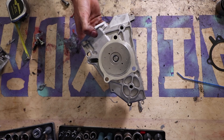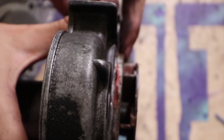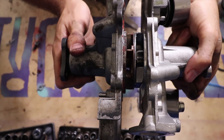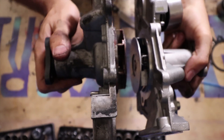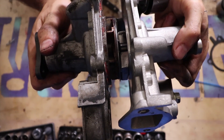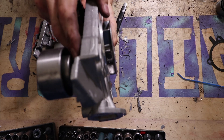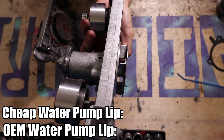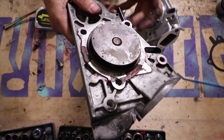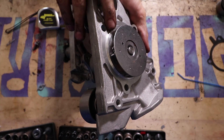Forget what we just did — this pump is shit. Bring in the OEM pump. So what we're looking at here: you see this lip? Much thicker — much, much thicker than this lip on the aftermarket. If you look at those two lips, you can see this is why you don't buy a cheap water pump. This OEM lip is going to have more sealing surface and secure it more, whereas this aftermarket lip is much less — almost half the size, maybe 25% of the size. It may not be the entire issue, but it's definitely part of it. This ring on the aftermarket is about an eighth of an inch, whereas the ring on the OEM pump is a quarter of an inch. The aftermarket pump looks nice and shiny, but that right there is probably one of the main sources of why this thing is leaking.